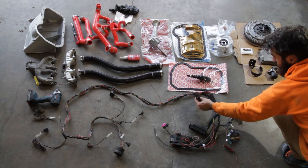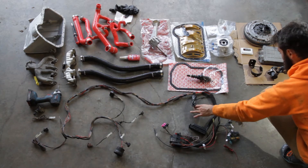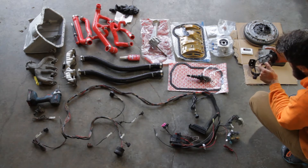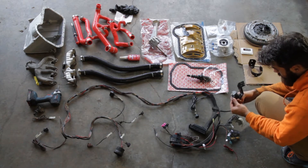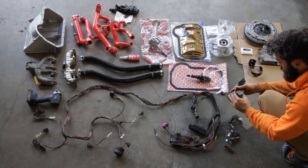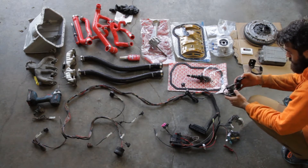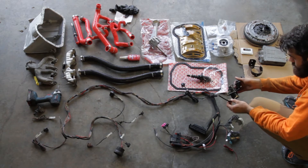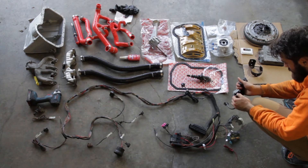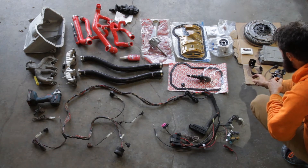Speaking of that, we were talking about the pedal. And the weird thing about this is it's not actually wire-driven — well, it's electronically driven — it's not cable, even though there is a cable. It's kind of a weird system. So there's this cable right here that you'll hook up to your pedal, and then you'll literally hook it up to this and they just connect together. But this is how you can do cruise control without having an extra module or anything, and also it is really nice because you can still use the cable from your van. We'll have to see where we're going to install that, but a few people have told me you could do it. So we'll be looking at that.